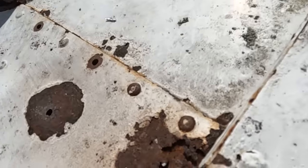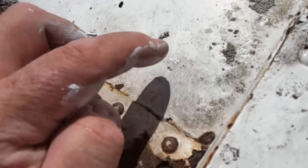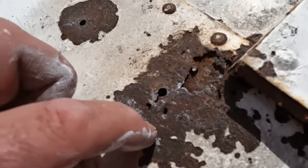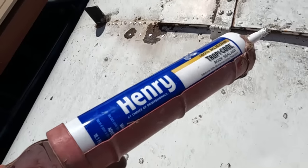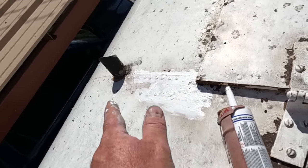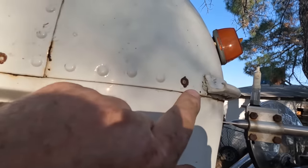Taking a close look at this rust hole — it isn't all the way through. It's through the top layer easily, but it looks like this layer went all the way past these rivets over here somewhere, so that's actually kind of solid. I'm going to start with replacing all the old rivets, then use some waterproof body filler, and magically the hole disappears and is waterproof. There's a few rivets missing here and there — I'm going to take care of those too.